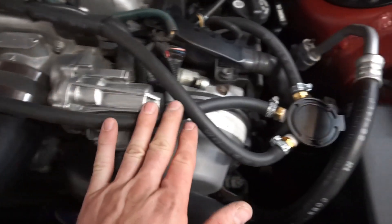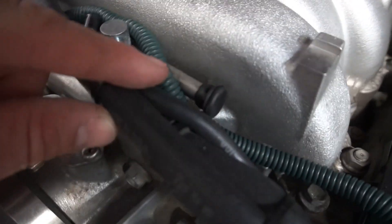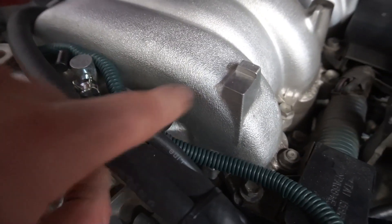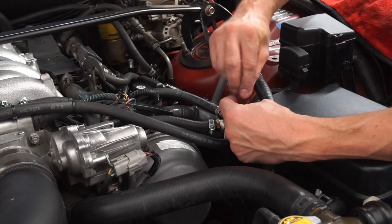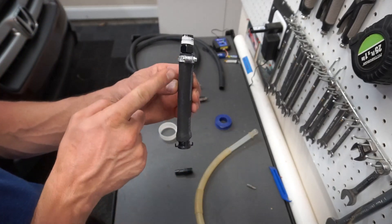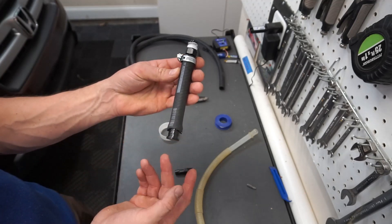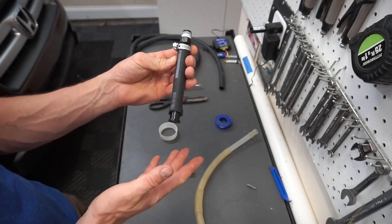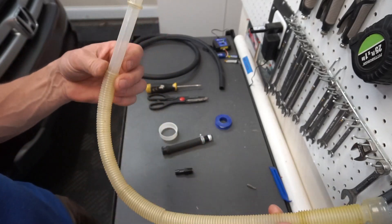I'm going to make the cut right over here — this will make it run properly. You're going to have to find some kind of plug up here; I just had this random cap that actually looks okay. Don't forget to tighten the fasteners we kept loose so we could rotate the can. The original drain design coming out of the bottom required you to unplug it to check for oil, and I always wanted something clear.